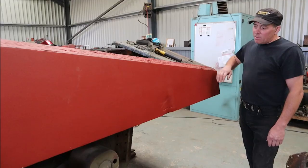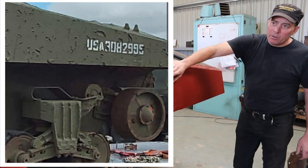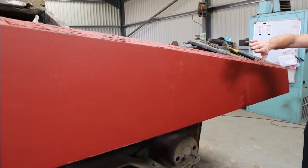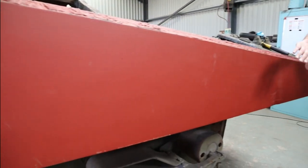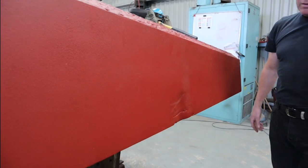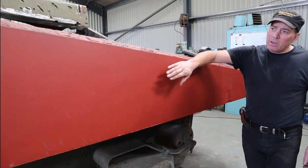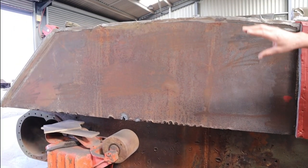You can see it's still a bit rough in odd places, but that's because they have a track carrier here for your spare links of track. When we've made them, we'll rub this down again and weld them on, so that's why it's a little bit rougher there. The rest of it's looking pretty good. This side here was nearly as bad as the far side — no penetrating marks, but there was a lot of dinks in it. We've welded them up, ground it back, and then given it a coat of red oxide very thick to fill any small blemishes. And then as you come along, this panel here...